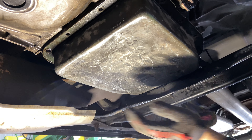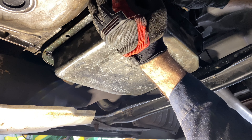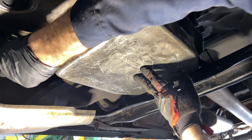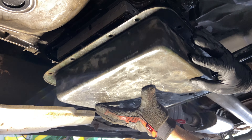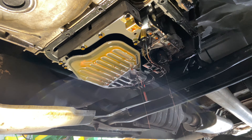At this point I've elected to leave one bolt here and one in the corner so it stays up — I've just loosened them a little bit. This bolt is stripped, things you find out every day. So I'm going to take out this last one and this pan is going to come right down. Typically there's a lot more fluid in here and it spills over the edges, but since I put this transmission in today the pan is pretty much empty. Here's the underside of your transmission in all its glory.